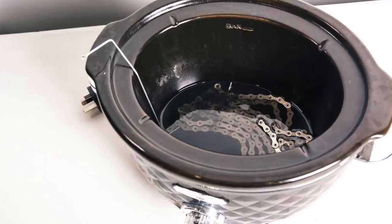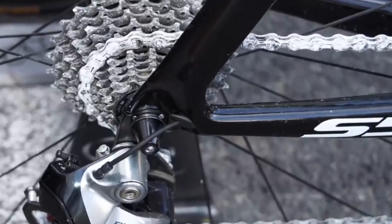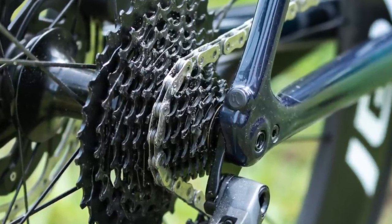On the other end of the spectrum, you've got people that wax their chain. The idea behind using wax as a chain lubricant is basically for three reasons. First, it's fast — the friction caused in the chain when using wax is quite low compared to standard old-school greases. It also makes your equipment last longer because the wax is less abrasive on your chain. Third, it's really easy to keep your chain clean, because as you ride around and the wax picks up dirt, it literally just flakes off and falls on the ground. So you never have to actually properly clean your chain — all you're doing is rubbing off that dirty wax, it falls on the ground, and then you reapply.